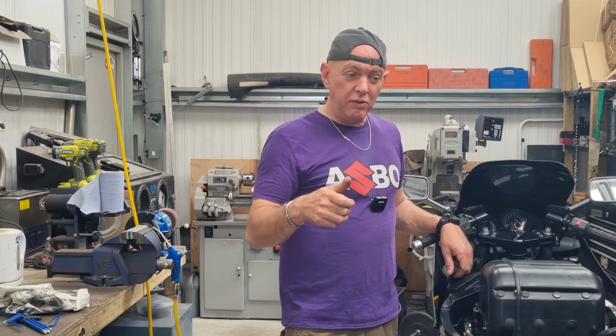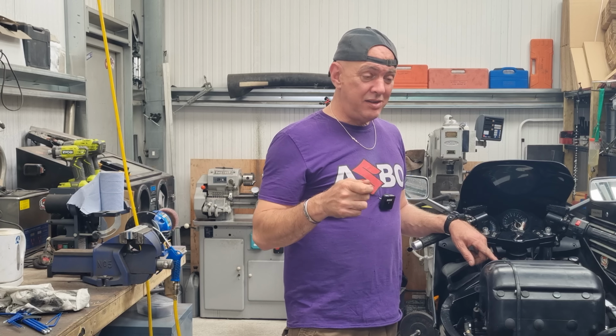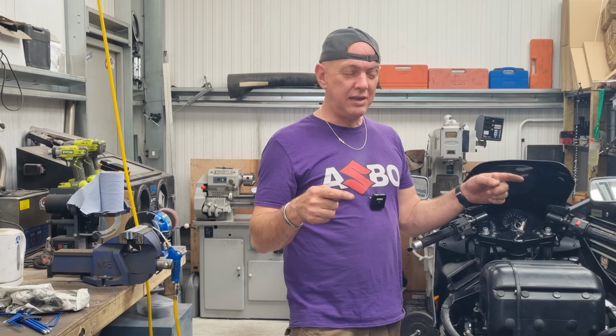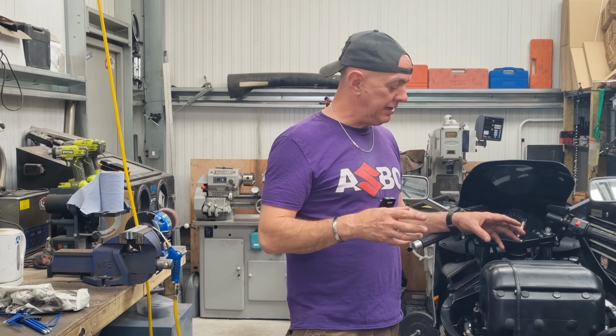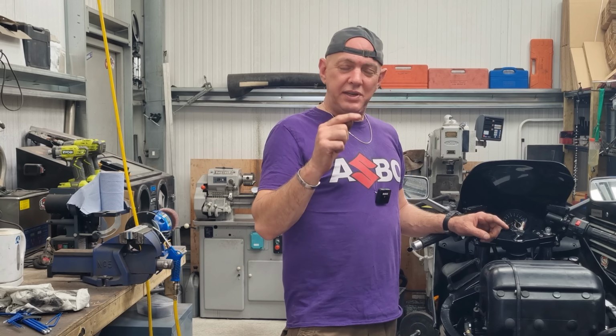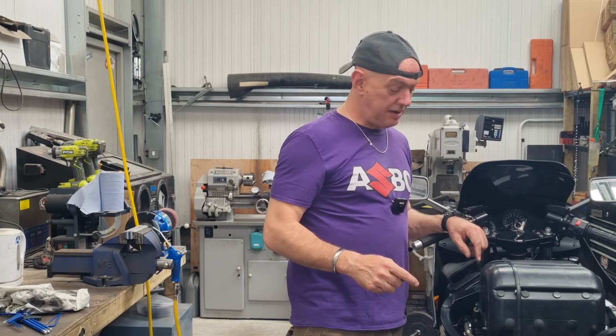So we shoved all that back on, fired it up again, and pulled off the HT lead for cylinder 2, and it just didn't change. So that's obviously where the problem is, but because we've switched over the leads and it all goes up to the same coil, it can't be the coil, it can't be the lead, and it can't be the spark plugs, because they've been switched over just now as well. So we're definitely looking at fueling, and at the carb on cylinder number 2.